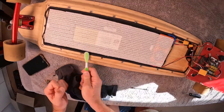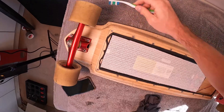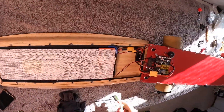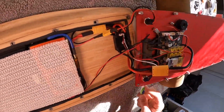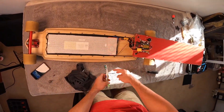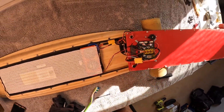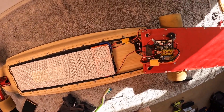I'm just going to use a toothbrush and get the majority of this stuff free of the seal. You can see that the majority of these inserts remain in the skateboard, though some of them have come out slightly — we're going to need to get them all back and level in the deck to put the lid down flat. So I'm using a toothbrush to remove dust and dirt from the seal region. While we're in here, we've got your battery, your BMS, your anti-spark, your ESC with your radio unit and alarm module, your power button and charge port — all squashed into a very small area, so we'll need to be careful when we put this back together.